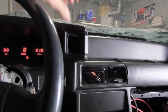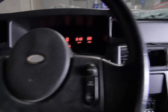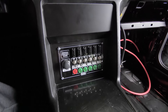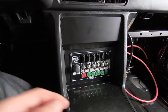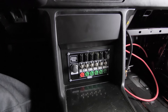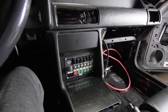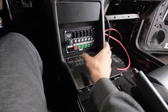All that good stuff works - I just got to put in the switches but I'll leave them behind the dash until we get the cage in for the final time. I think it's just going to be better to do the cage now than later. One more thing - the switches: I could wire in the fuel pump switch right now, but I don't think it'd be a good idea to dry test it without fuel. The wire is back there so it's ready to go - I just got to wire it in and wire the 12 volts to the switch panel. I have a temporary connection down there just to test things out but everything works. Plans for the shifter - I'm pretty sure I'll be able to set it kind of right here because that's where the old stick shift was.